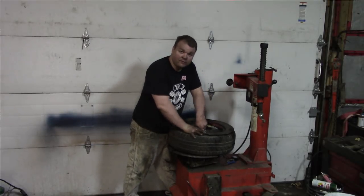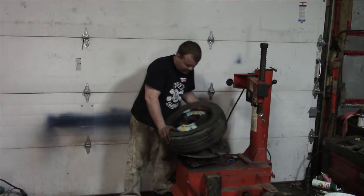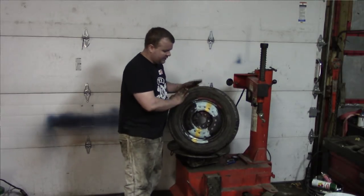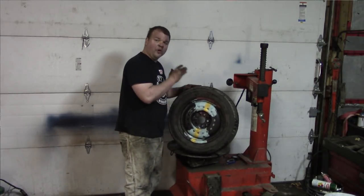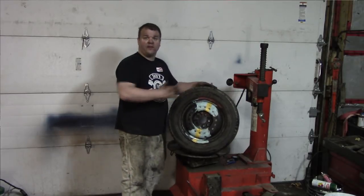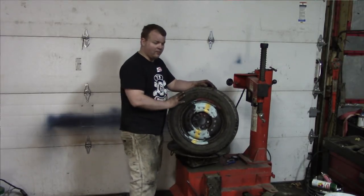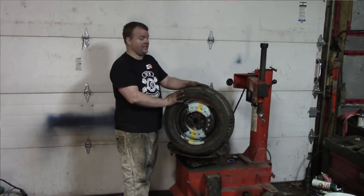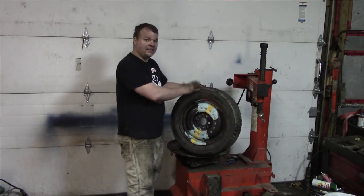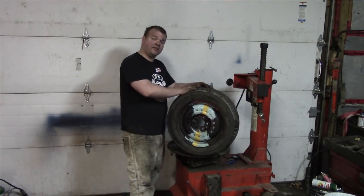These have a different set of rules here in Ontario. The reason why they have a different set of rules is because these have a nasty habit of getting ripped apart and thrown into the stands. So here in Ontario, we are allowed to run these, but we're not allowed to run these on drive tires. On a front wheel drive, we cannot have these on the front of the car, and on a rear wheel drive, we cannot have these on the back of the car. But these do help out, and in some places they do allow it. A lot of places down in the US, I know they do allow it. You can choose to tube these tires or not tube them — that is your call. I don't really even see a need to tube them when you do this. That is a pretty thick side of a tire that will actually protect your actual tire.